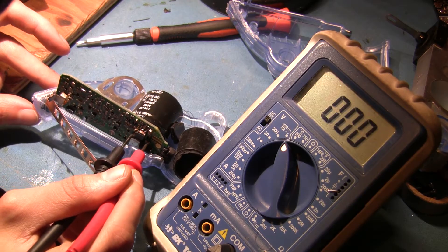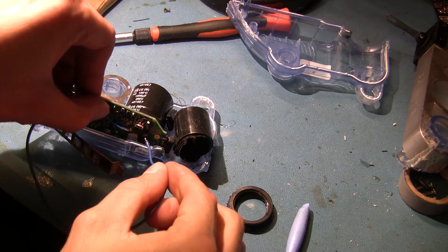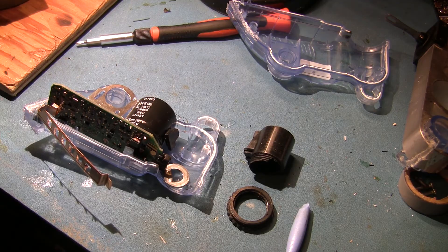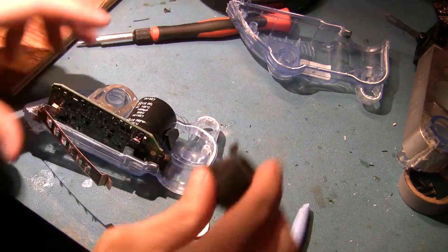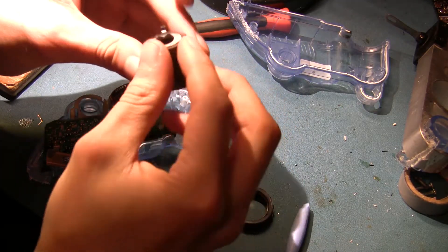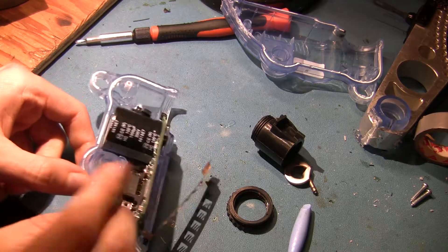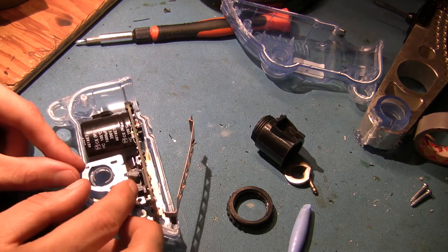DC volts — okay, so there's nothing left according to the meter. Oh, it's 1,000 microfarad, not 7,000 — at the top it looked like 7, but anyway, something like this will definitely give you quite the shock. So here's the bottom assembly — looks like it fit in like this. There's a piece of metal here holding down a contact on this microswitch, so they definitely know I'm in there. Perhaps it's a safety thing that discharges the cap if there's human ingress.